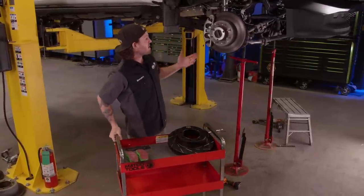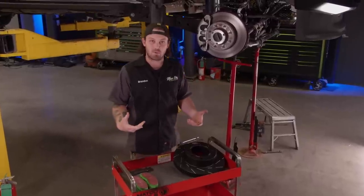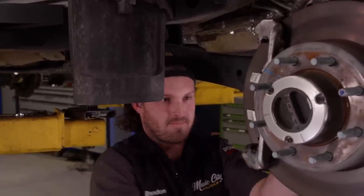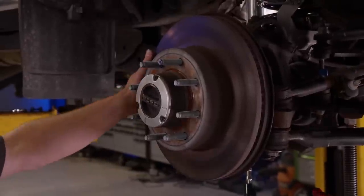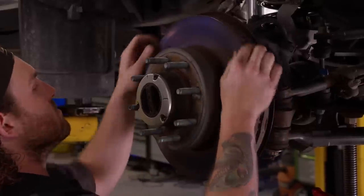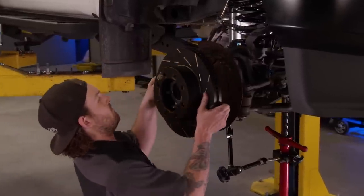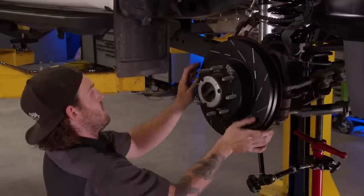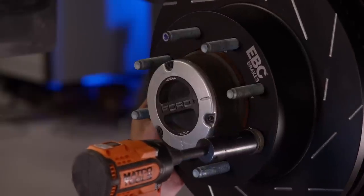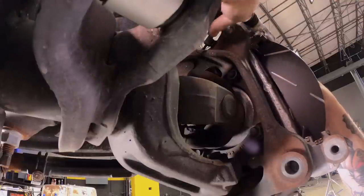Since we upgraded wheels and tires, we're gonna be upgrading the brakes as well. We're gonna be doing that with EBC Brakes USR rotors. And for this truck, we're gonna be using the Green Stuff brake pads, so we keep plenty of stopping power. Before these parts go on, obviously the old ones gotta come off. These brakes are pretty much brand new, but since we're upgrading our tire size, we want to increase our stopping power to compensate. These EBC slotted sport rotors are super quiet, slotted to cool and degas brakes, eliminating air noise. The black GeoMet finish helps resist corrosion and removes gas, dirt, water, and debris, while providing parallel pad wear for improved braking.